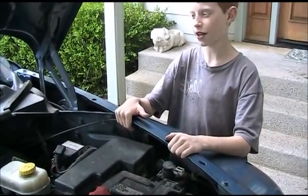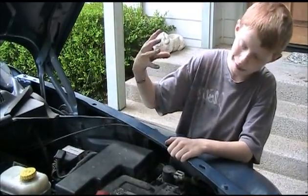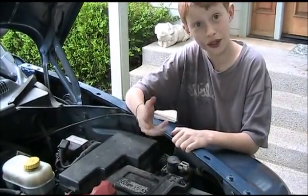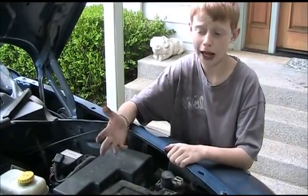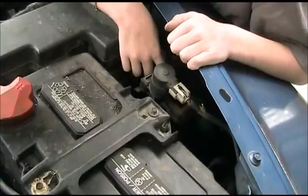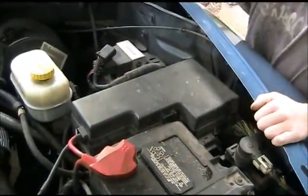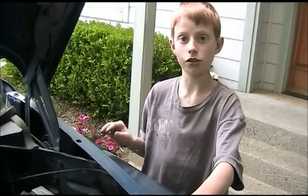I'm doing this the old-fashioned way. Usually people would pump smoke in there and they'll find where the leak is, but I'm not going to do that. Now, these two hoses go over the transmission to the evap canister. Let me show you where the canister is.